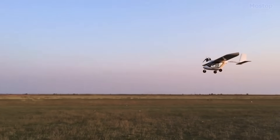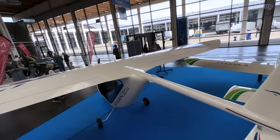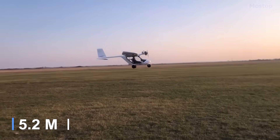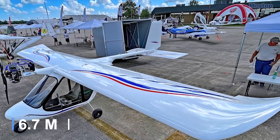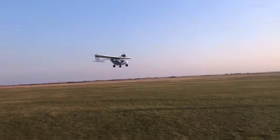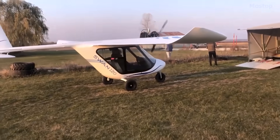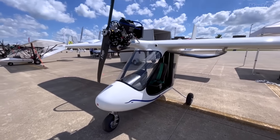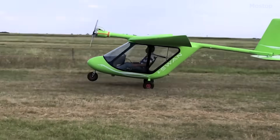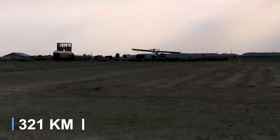The airframe is made from vacuum-formed and thermally treated carbon fiber or glass fiber with epoxy resin. This aircraft has an empty weight of 244 pounds, a length of 17 feet, and a wingspan of 22 feet. The versatility of this ultralight aircraft shines through its ability to be easily folded in various dimensions — from length to width and height — making transportation and parking hassle-free. Powered by a Polini Thor 303 engine generating 38 horsepower, it can cruise at speeds of 62 miles per hour and has a range of 200 miles.